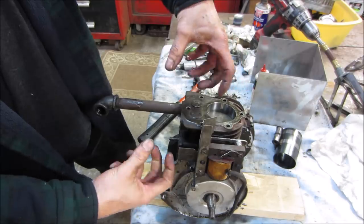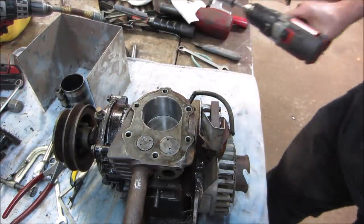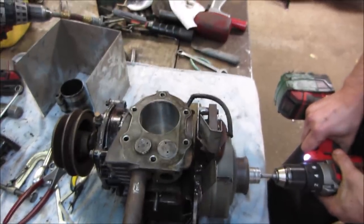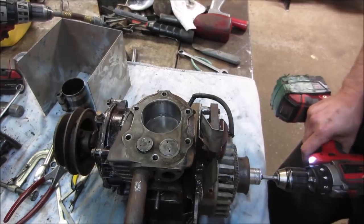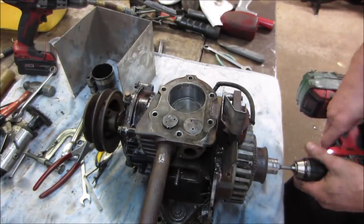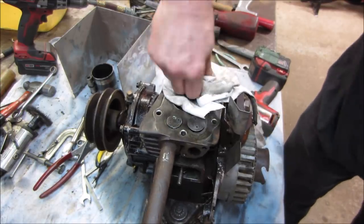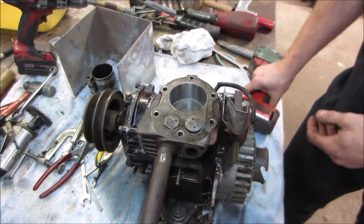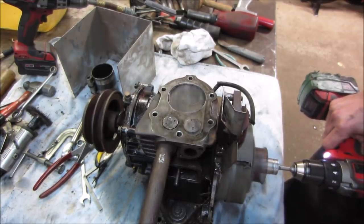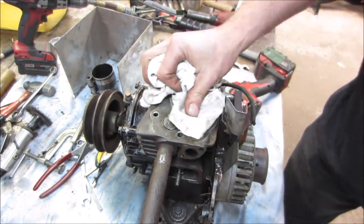Now I'm going to work the crankshaft and the bottom of the rod together, get them lined up with oil, cap it back together. All right, so the crankcase is back on, got oil in it, everything but basically the cylinder head. So let's spin it up and we'll see how much oil gets by the rings. Should probably back you guys up a little, huh? Because there is some from assembly, you know. Yeah, decent amount. Pretty much the same as what it was before.